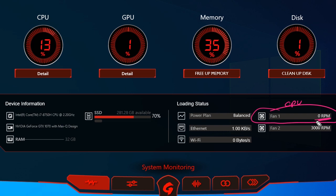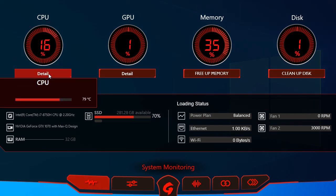To check on the heat for the CPU, we can go up here to CPU and click on Detail — it'll show us the heat level. Currently it's at 79, 78°C. I do have some recording software running right now, and anytime it gets higher than 85 or 90°C — 100°C is boiling — that becomes a serious concern. So here's what I did.